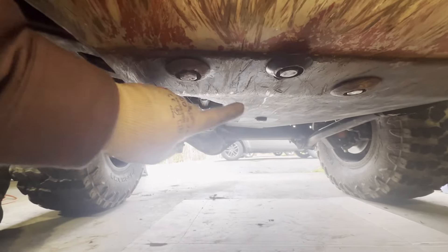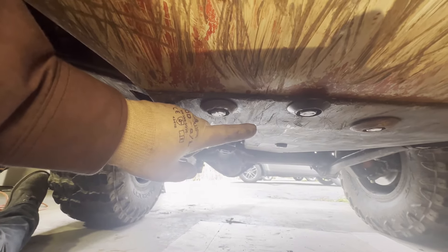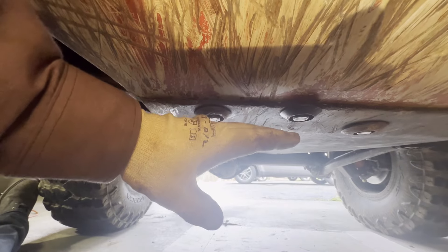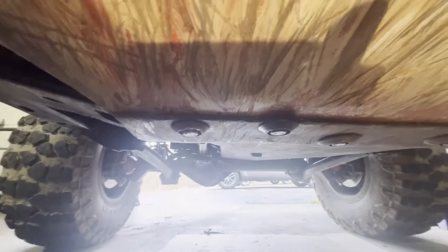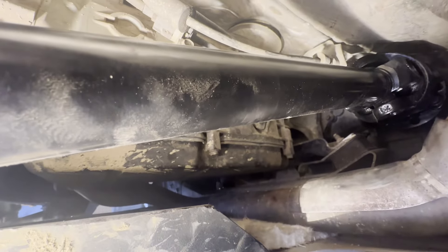The crossover pipe comes across and really comes down on an angle very close to the transmission support bar. Sometimes you can get some strange vibrations in reverse or at low RPM. I ended up sandwiching a really nice 3/8ths to half-inch piece of very high-temp insulation between the top of the engine skid plate and the bottom of the crossover pipe. It's just sandwiched in there — can't hurt anything, makes a nice cushion, isn't going anywhere, and will provide a little more silence.